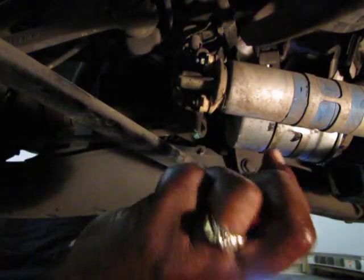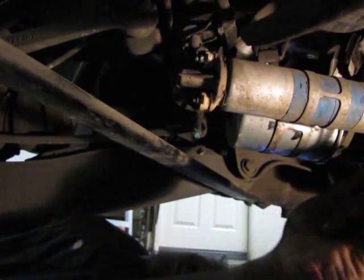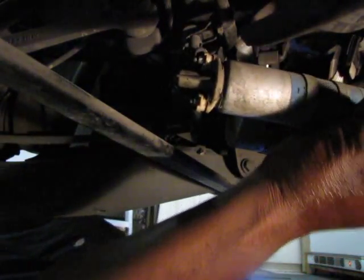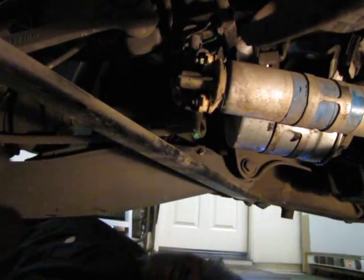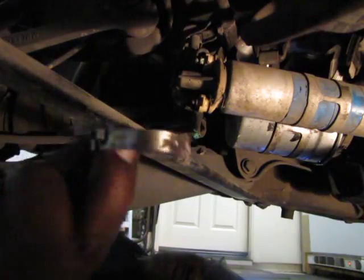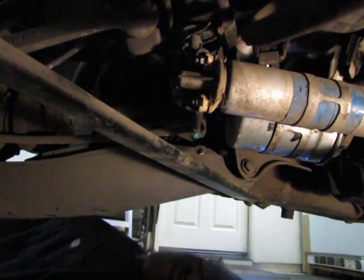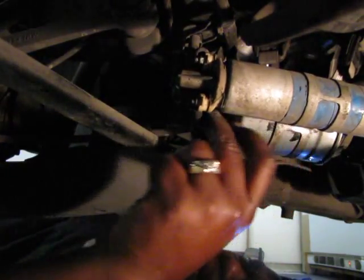And here's the weird part. I'm either going to replace these, jeez. So the clamps on the fuel pump, they're crimped. So I'm going to have to destroy these and then replace them. I'm going to take these off and replace them with the regular kind that you screw down, which is fine. So that got that one loose. See, they have these little crimped type hose clamps. You can't reuse those. And then the other side is, see, I should have got a longer screwdriver for this side.